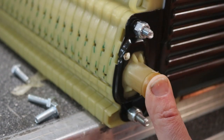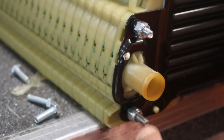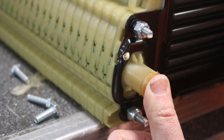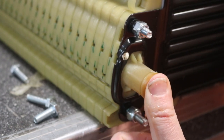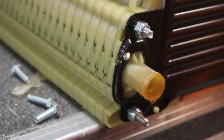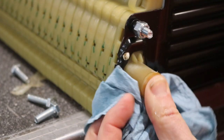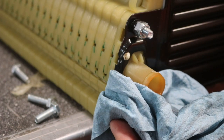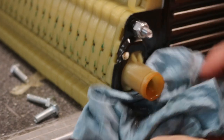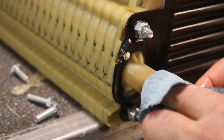I'm going to put some air pressure on the other connector, block it, apply pressure, and then release it. Sure enough, we even blew some coolant out of there — wow, more than I thought actually. I would have grabbed a bucket instead of a paper towel.